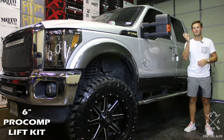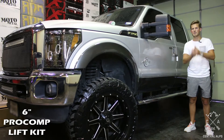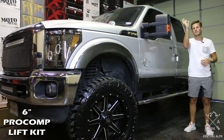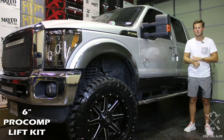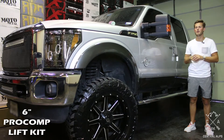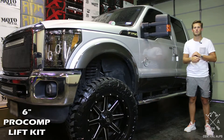If you just go get one of the small cheap ones, unless it's a brand new truck — and we're in 2018 right now so you won't get a brand new 2016 truck — you're going to have an issue. You're going to have a hard time pulling the pitman arm. So make sure before you do this install you have a heavy duty pitman arm puller. You can probably get one from Amazon or any other major tool store.